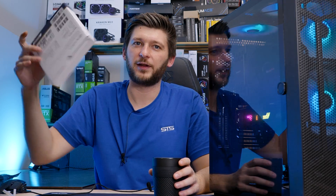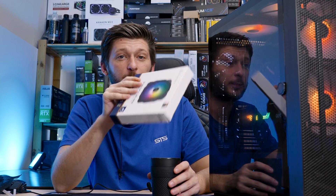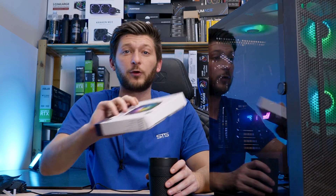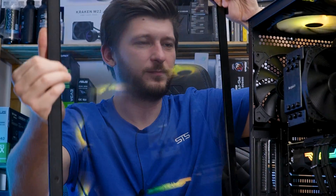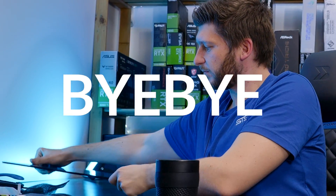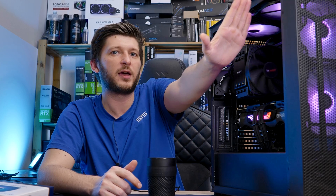Exchanging the original fans for Shark Force 160s and especially adding some in the top is a great idea — especially on the top, it's a very good idea. But if you want to do it, do not make both of the top fans exhaust fans. Otherwise you will just throw away a lot of potential cold air and it doesn't make any sense. Either no fan or intake — otherwise it just doesn't make sense.